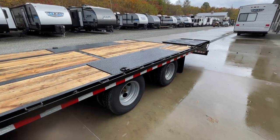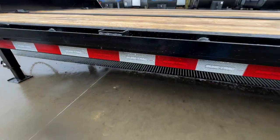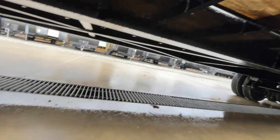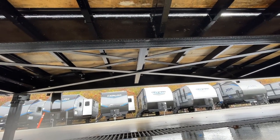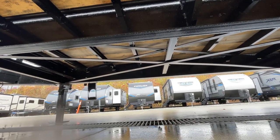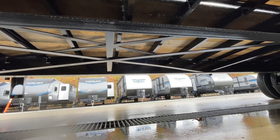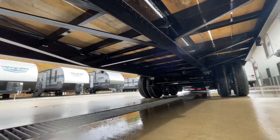As this is a low-pro, part of getting it down lower, you'll know it's a pierced beam — you'll see the top of the I-beam and then the tread plate over your fender well areas. The unit has outriggers on approximately four-foot centers. This is USA steel. Sticking our head underneath, this unit has what ShoreTrak calls cross-track bracing, which replaces what some manufacturers call a torque tube. The cross-track bracing is a little lighter — saving weight — but is actually more effective at tying together the trailer and keeping it from flexing in an off-road application.